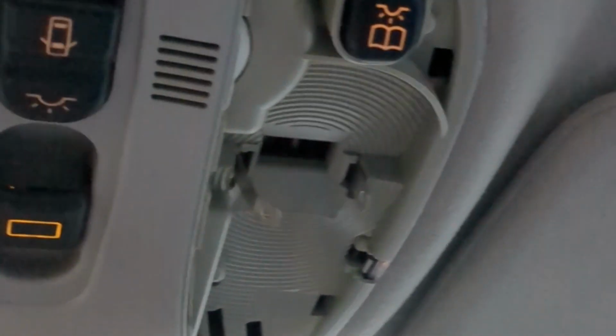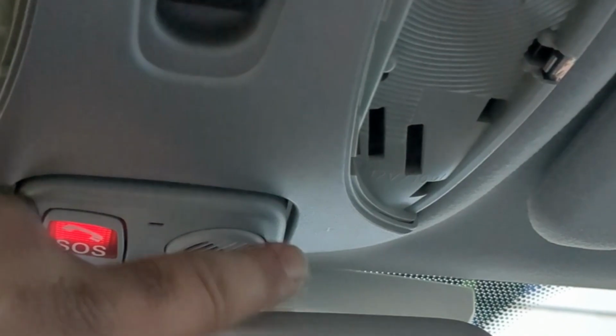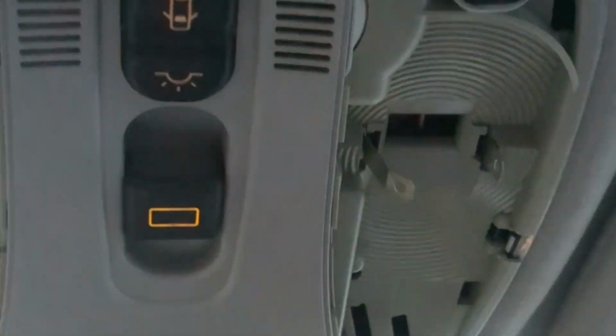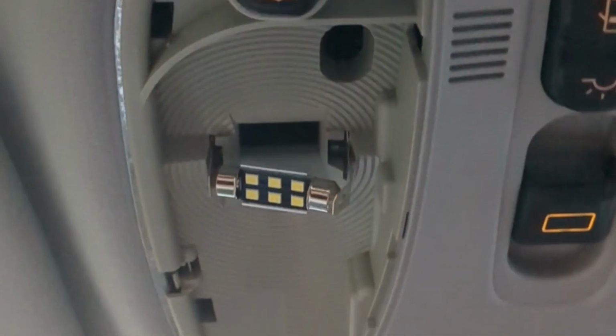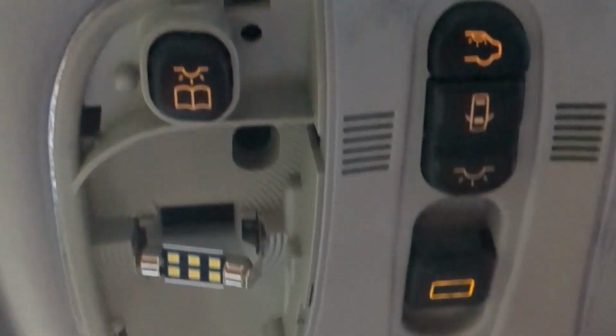And there it is. Once you put everything back in place, check the lights, check the overhead lights, the rear light, that everything is working properly, and your convenience lights on your mirrors. Just push the buttons, make sure everything is right. It's really hard to screw this thing up. There it is. Everything's good. So at this point you're done. All you need to do is then put the white plastic lenses on top of the lights. Those snap in place very easily.